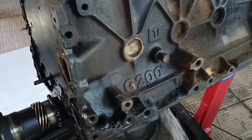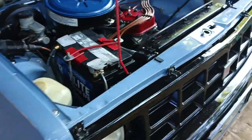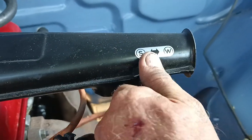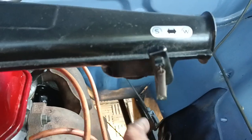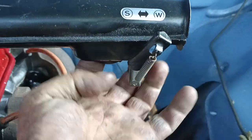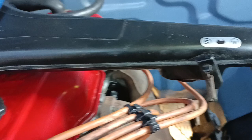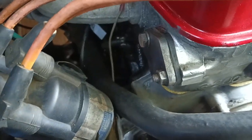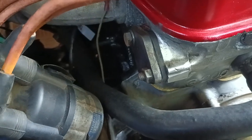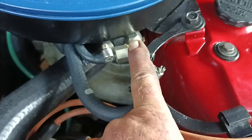Luckily we have not one but two G200 engines. Here's our interesting summer/winter selection - it just diverted a path coming from the manifold that would put warm air into the motor to get it warm quicker. In summer it's open one way, in winter the other, but I've cut that off because it was rubbing on the HT leads. The mechanical fuel pump works, but we'd already put an electronic one in. We've taken an 8mm hose pipe with a tee piece and a 3mm hose out, which works as a pressure regulator.